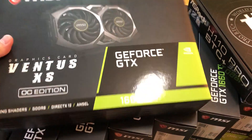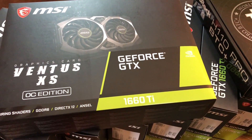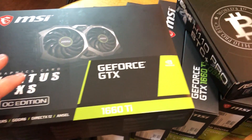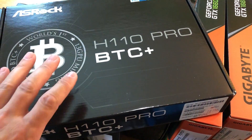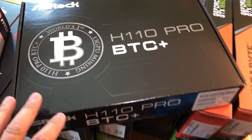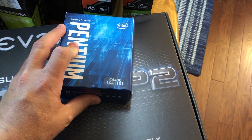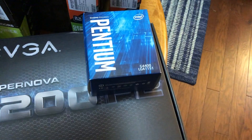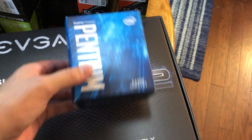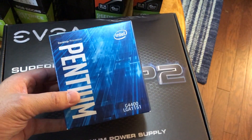So here's what we've got. We've got the 1660 Ti's — I ordered eight new cards on top of the other cards you've seen already on this channel. We're going to incorporate some of those used for testing in the past to get to 13 cards. The board we're going to use is an H110 Pro BTC Plus board — you can still get this for around $50 on Amazon. We're doing an EVGA 1200 watt P2 power supply, along with the Pentium G4400, an LGA 1151 socket processor. We did pick this up before it became scarce on Amazon, so you may have to substitute another processor for any new builds.